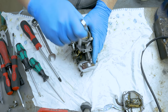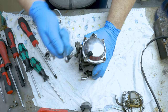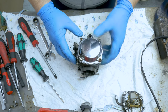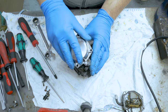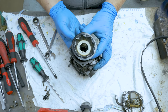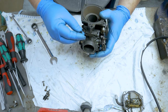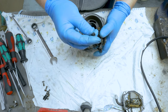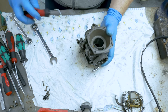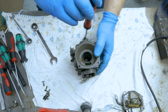Moving on to the heater - looks like a 10mm, same as the other one. This one seems to not have that white gunk on it which the other one had. We're going to take out the membrane. I've got my little security torx for that screw - that works. Hold this down and spin them out. I'm just going to push this out from the bottom up. Let's have a look at this pilot screw - I couldn't get the other one out. This one is nice and shiny in the hole and the cover rubber is not dirty.